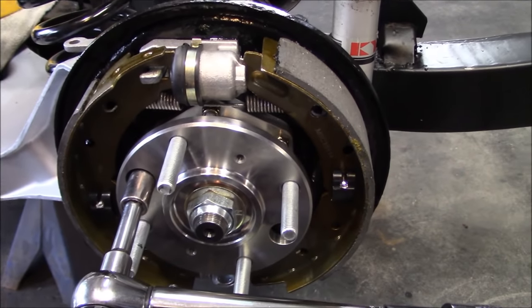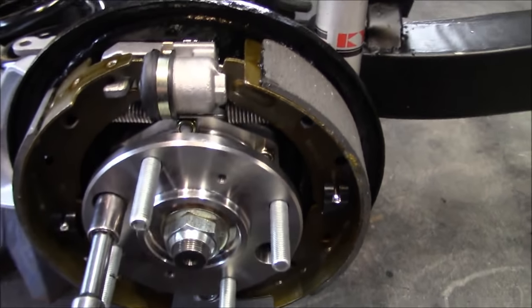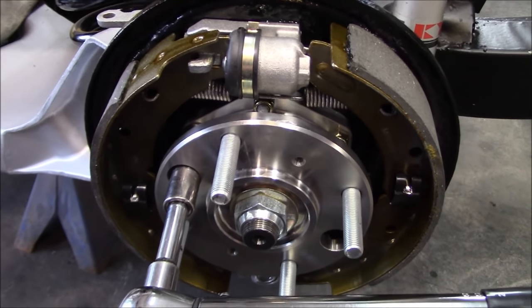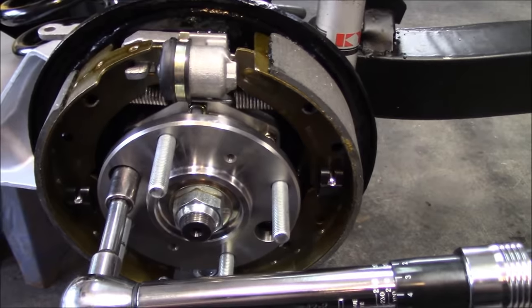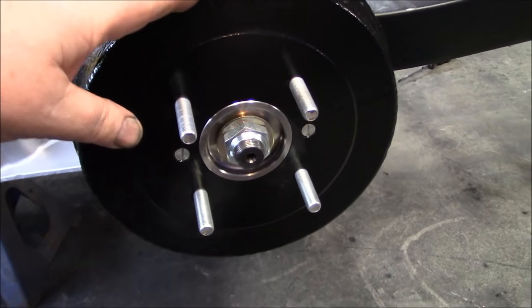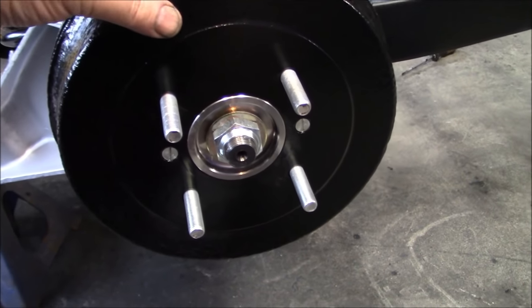Back on the rear hubs and just about to get them torqued. As I mentioned, it's not a very high torque value: 16 foot-pounds, which is equivalent to about 22 Newton meters. I've got my smallest torque wrench here. We'll do all the fasteners and move on to the other side, then put the drums on and call this rear end done for now. Brake drums are back on with new brake retaining screws — they look nice and clean and shiny. I kind of wish I had the old finned aluminum ones like I have on my TR6. Might be an upgrade in the future, but they're quite pricey — something like a couple hundred dollars a drum, so about $600 Canadian for the pair. The stock drums will have to do for now.